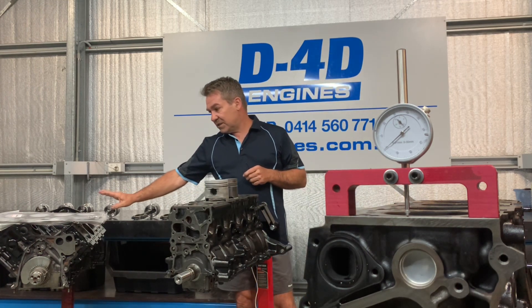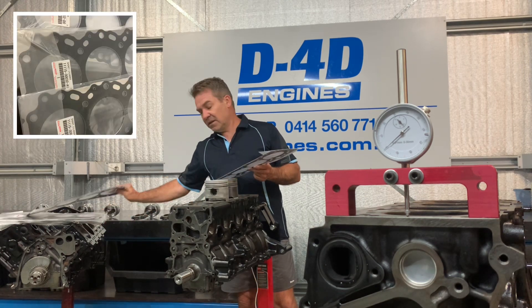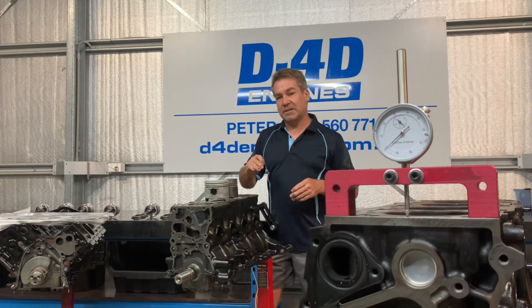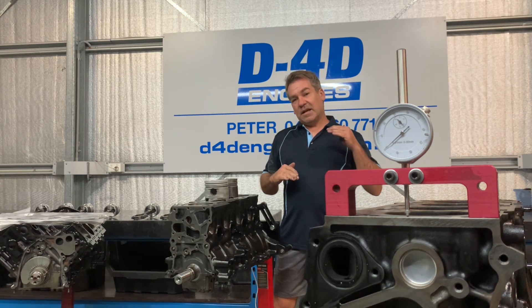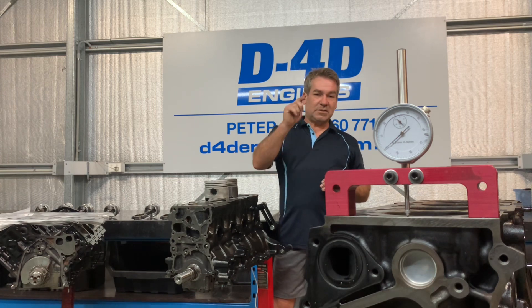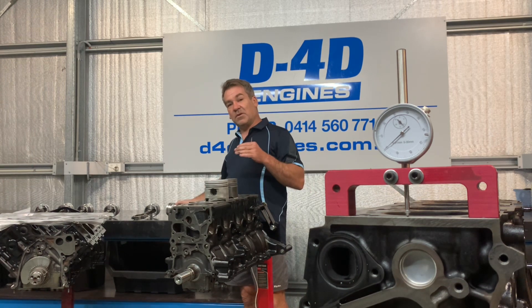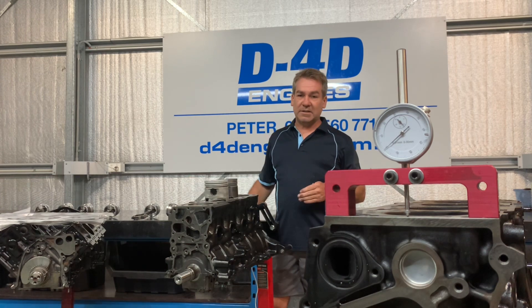With the head gasket it's simply a matter of keeping them all in stock. Toyota uses letters — so that's an E which is the thickest one, and that's an A which is the thinnest one. You just take the measurement and fit the appropriate head gasket to match the piston protrusion you have. It is very important because that sets the efficiency of the engine over its life. For a few minutes to take a reading and select the right gasket — it's worth it. Online rebuild kits now all have E head gaskets in them, which is cheap and nasty.